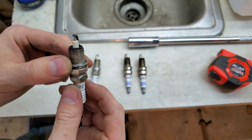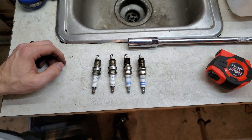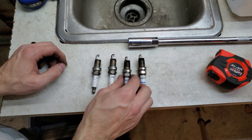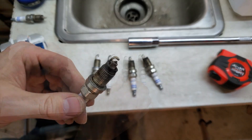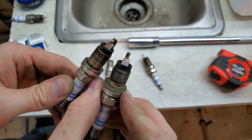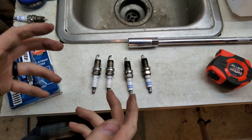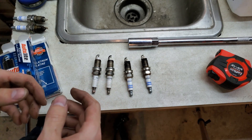These two other plugs are iridium plugs that I put in prior to going to Moab, which would have been a year ago, so these have been in over a year. When I went to Moab, I had a leak before the O2 sensor in the exhaust, meaning that anything in closed loop was going to be wrong. What's fascinating to me is just how much cleaner the plug that's been in there longer is. I'm thinking that now that I'm running a more rich mixture, the additional gasoline is going in and starting to clean these plugs off and make them a little more shiny — which is telling me I might be a little too much on the gas.